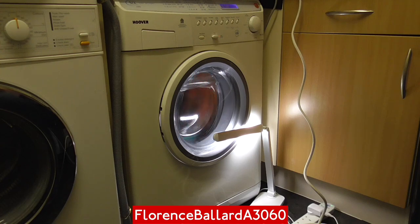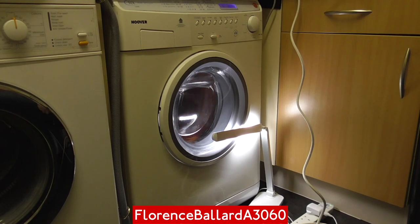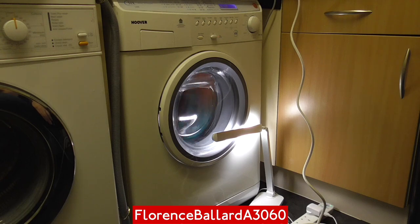I'm trying to think what machines I know that when they don't balance correctly, or they spend time balancing, they'll skip part of the burst. They'll just shoot up straight. I know the Miele, if you pause it on the minimum line final spin, it will abort the previous burst that it did. It won't redo it. So I can effectively get it to go up to 1300 straight away in one go. I have actually done that before, and create like a massive water lock on it. That's going to be a video I'll do. Final spin, I'll just put a soaking load of towels in there.